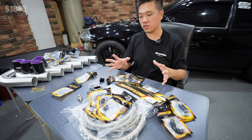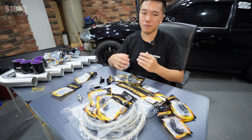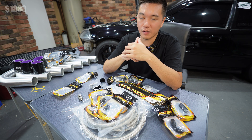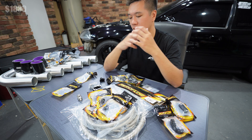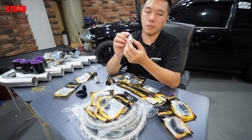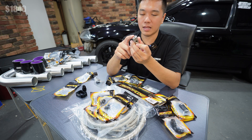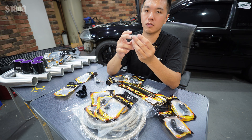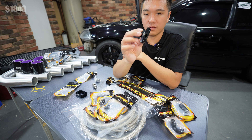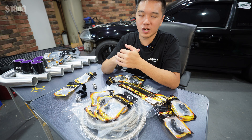Just as important as the rest of the kit are all your lines and fittings to plumb up the turbo to the engine. I've gone with Aeroflow for this build — it fits the budget better, and I've used both Aeroflow and Speedflow without ever having a fitting leak. The GT2860RS is both water-cooled and oil-lubricated, so we need lines for both water and oil feed and returns. On the oil side, we'll feed the turbo through a T-fitting that replaces the oil pressure switch on the back of the block — it's an 1/8 BSP tapered thread. I'll probably replace it with a Bosch temperature-pressure sensor to read data on the ECU.